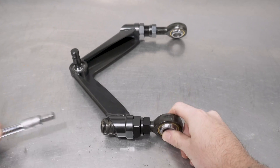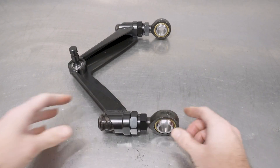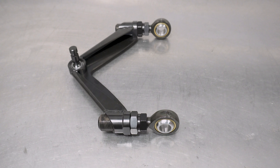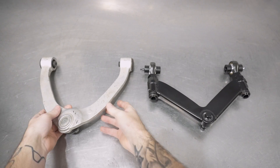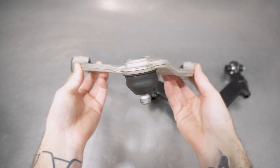If you are going for that hot boy — spelled B-O-I — slamber, that's slammed with camber, you can run these at minimum safe adjustment, that being 29 millimeters tip-to-tail measured like before. Because of maths, that gives you 57 millimeters of negative adjustment compared to OEM, which is around 5 degrees of negative camber. You also get 20 millimeters of positive adjustment for those of you building a dune buggy for some reason, which translates to about 1.6 degrees of positive. Keep in mind there are many things that affect camber, so these are just rough figures to go by.